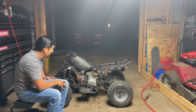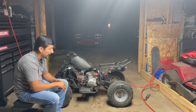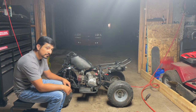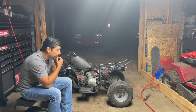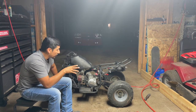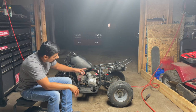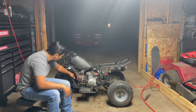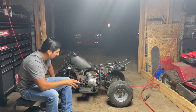I did put some money into it but not a lot. I painted the ATV rims to match the bottom part of the plastics. I also put a new wiring harness — the old one was kind of messed up. The owner before me had splices throughout the wiring and had a toggle switch to turn it on. Now the toggle switch is going to be on the handlebars. The lights work now; I still need to get a headlight. I put a new air filter and completely went through the carb.